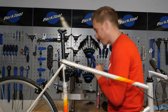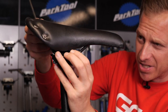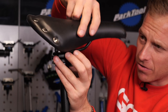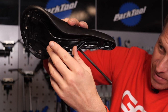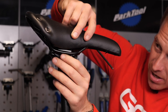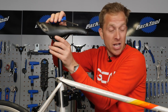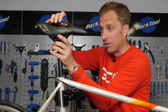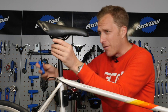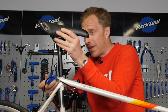Just going to put the saddle on and we are done. Now it's just a case of fitting on this saddle — like I said in the last episode, not sure how long it will stay on, but it's certainly alright for an interim bit of kit. Just need to try and get it in the fiddly micro-adjust clamp here. Then it's a case of levelling everything out. Remember, we still need to line up the handlebar stem to make sure it's perfectly straight in line with the front wheel, and also the angle of the handlebars and the brake levers too. Once it's out of the stand, it's much easier to do that because of course you are generally on a level surface. Let me know about this video and what you've thought about it, and in fact the whole series — let me know down there in the comments section.